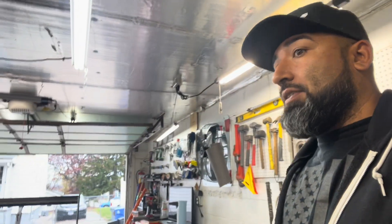I'll order some more resin — should be here in a couple days — and I'm just going to go over this section and any low spots. You can kind of see where it's still textured — the carbon cloth is like sucking it in. Once I get this all done, I'll go over all the low spots, sand the whole thing, look for any more low spots, clean it, add a little bit more epoxy, and then we should be good. If that part where the glass is turns out good I'll paint this whole part just like how the stock hatch is painted and just leave the glass part carbon — I think that would look pretty good.